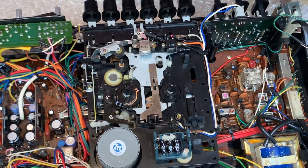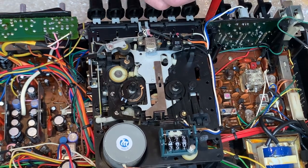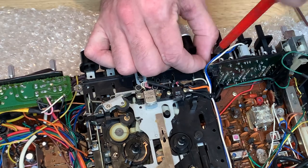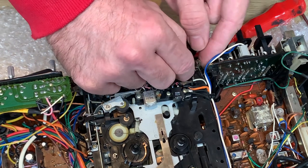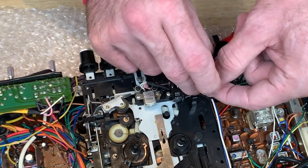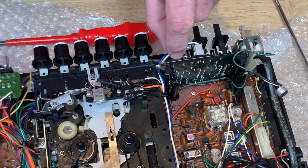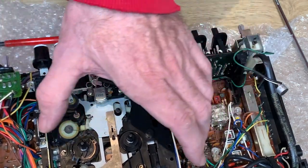So there's one screw, and then the other one is just in the opposite corner. Once you've got those four screws out, I'm going to take this one out of the eyelet - if I don't, it'll fall out in the middle of the mechanism when you're not expecting it. The only thing that remains for access is the multi-connector here, this little double connector - if we pull that one out we should now be free to gently extricate the cassette mechanism.